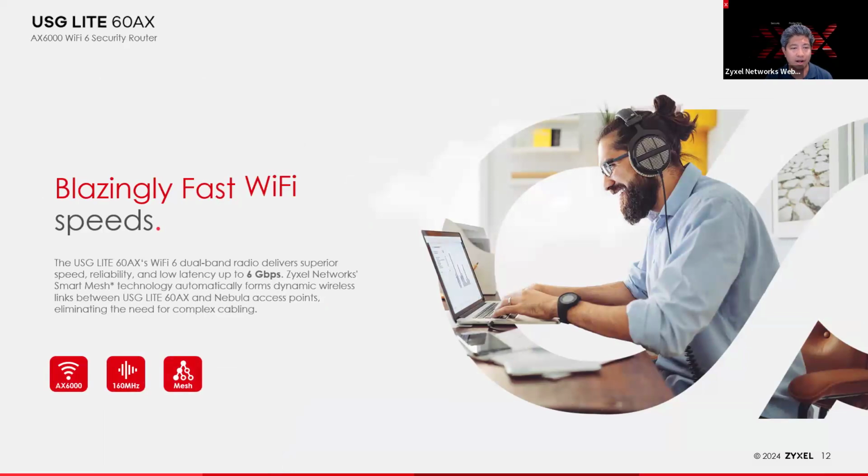And it offers blazing fast Wi-Fi speeds, Wi-Fi 6, dual band radio, gives you up to 6 gigabits per second, but that's obviously the PHY speed, the theoretical speed of it. But I think the biggest differentiator of this model versus the SCR 50AXE is that it allows you to do smart meshing. The Zyxel smart mesh technology allows you to form wireless links to another access point dynamically or automatically without having to run a wire, without having to run cabling. So this makes it a great small business extension type capable device. The beautiful thing is that it will work with any of our Nebula capable Wi-Fi access points that we sell today. So anything that supports that smart mesh can mesh directly to this device.